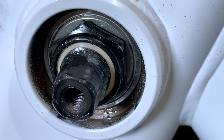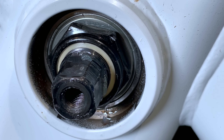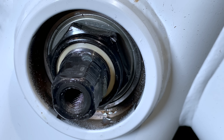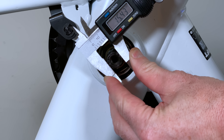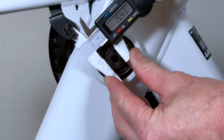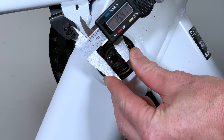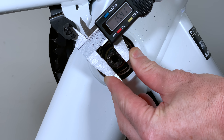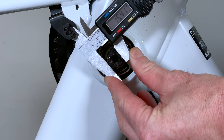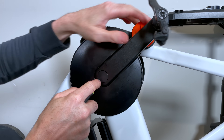I'm told they've been tested through to 25,000 kilometers and given it's indoors and quite protected, I expect these will last longer than a bottom bracket outdoors. My rough measurement of the square taper bottom bracket is 15.43mm on the calipers; the official spec is 14.8mm, which is well over the 12.6mm standard for square taper bottom brackets. So crank compatibility is pretty much a no at this point.